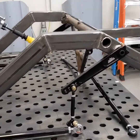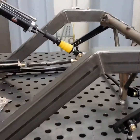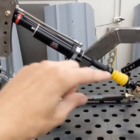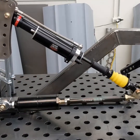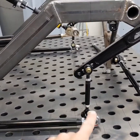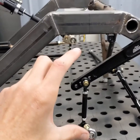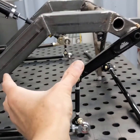The rear suspension is effectively a three-link rear suspension — you've got one link here, one link here, and one link here. This setup in particular is called a decoupled three-link. You've got this link that's broken into two pieces: an upper and a lower — this is the accelerator link and this is the decelerator link. The rear of the housing bolts into the lower control arms and the top of the housing bolts into that decoupled three-link. When the car accelerates hard, the tires rotate in a way that makes the housing twist.